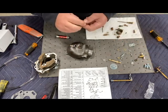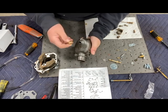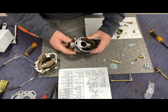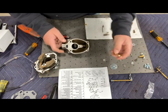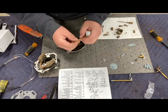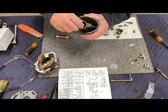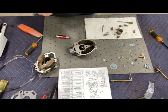Right here on the bottom is just your drain plug. I'll go ahead and put that on — there's no gasket that I see for it, so I'll snug it up in a bit. Now we're ready for our main nozzle — here's the new one. We'll have a gasket that fits on it — the little red one fits on nicely. We'll slide the main nozzle down in there and snug it up with a three-eighths wrench.